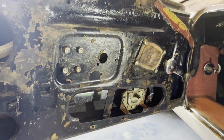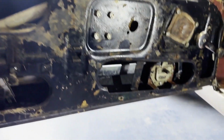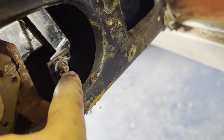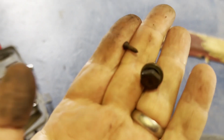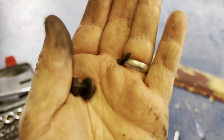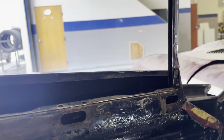Okay, back on the passenger door side of the E-Type, I'm looking to take out this chromed window runner. There's 2 bolts, one here and then one here, and then there's 2 small screws. There is one just there, and then one is here on the other side. There's a small little screw. There's 2 of those holding it in. This bolt on this side, and then a nut comes off the bolt on that side. And then, because I've already taken these little holders, they should all just pull out.